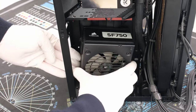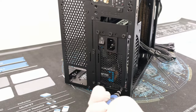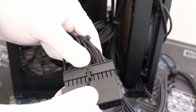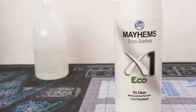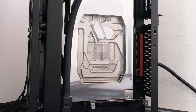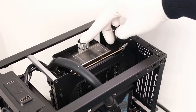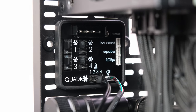We are using the Corsair SF750 SFX Type 4 power supply to power this ITX build. For the fill, let's connect the pump to power and also put a jumper on the main 24-pin power cable. We are using the coolant with low conductivity — Mayhem's X1 Eco Coolant in clear. After the fill, let's add another Barrow manual exhaust valve. Next, let's install the AquaComputer Quadro to control the loop. Let's plug in the motherboard cable, coolant sensor, ambient temp sensor, pump, fans, and Molex connection for power.